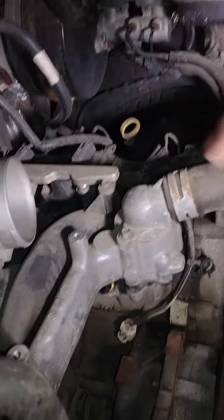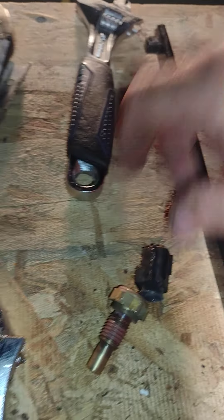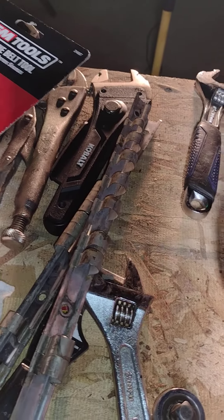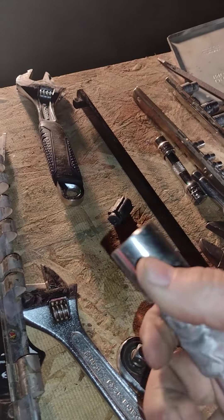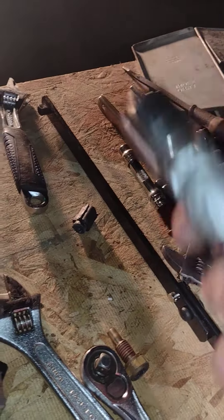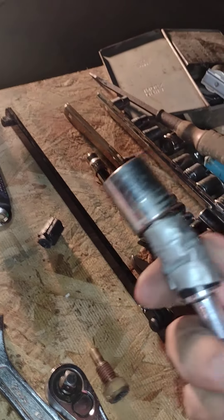Here's what I recommend to get that coolant temperature sensor out of the engine. I have the old sensor here with the top busted off — I did that on purpose. This is a 19 millimeter. Once I broke the top off I could get the socket right in there. I put tape on my swivels so they don't flop around — they'll still swivel but won't fight you. You will need a swivel to get in there because it's at an angle, but you can back it right out no problem. So: 19 millimeter socket with a 3/8 swivel and extension.